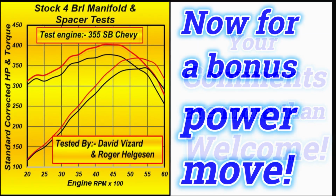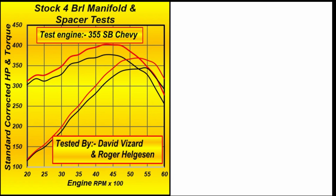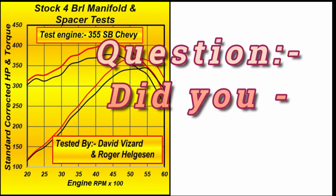At this point, we stepped out of the stealth mode and just tried something else. What was done for this curve, and you can see the gain from the fade out from the previous one, is we made up what has now become known as a super sucker spacer. That is a spacer where you start off with the same pattern as the carburetor and end up with the same pattern shape as the plenum. Well, what we did here was put two 1/2-inch spacers together and do just that.